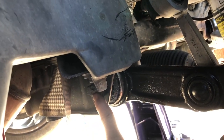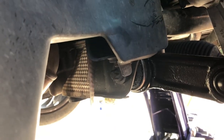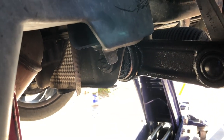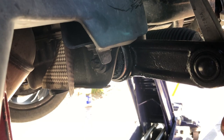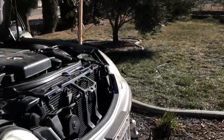One tool I did not have was the larger-size E-Torx socket, but what I found was that a 14-millimeter 12-point wrench will hold that just fine as you ratchet the other side — I believe with the 21-millimeter. So that's a couple of tips there.